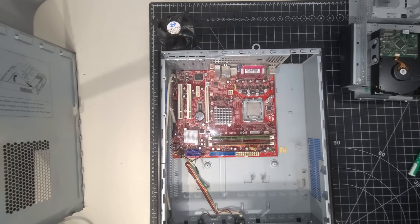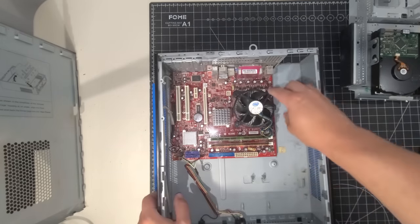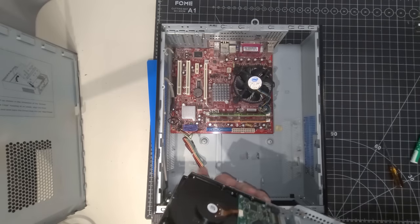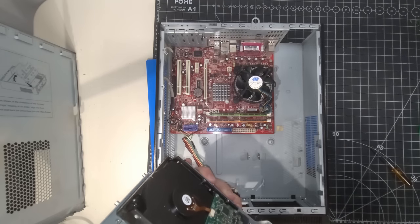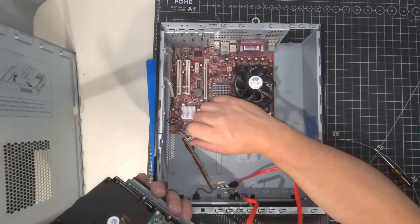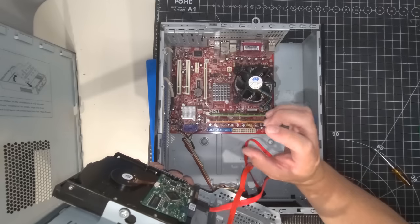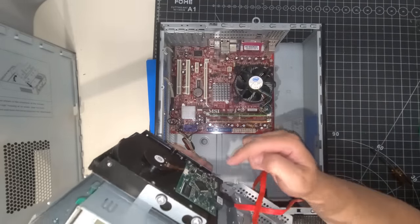We're going to get some thermal grease and get that installed. We have the heat sink and fan nicely mounted on there. I did a jump cut because there was some messing around with this mounting system — these are little pegs that expand behind the motherboard when you pop them down. It took some finagling but we got it done. I'm going to pop in our drive data cables and we'll use those little clips to manage the cables. We don't have our original power supply because it's bad, so we're going to use the temporary power supply.